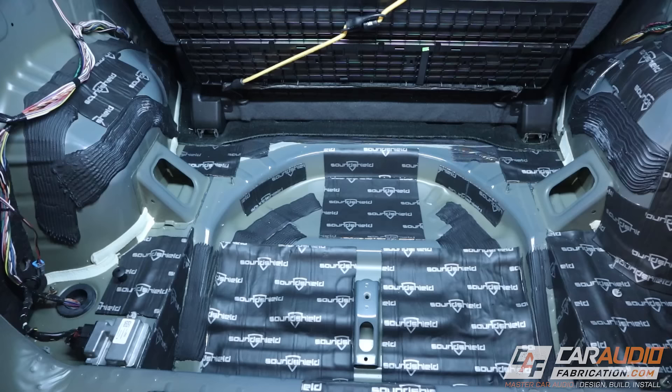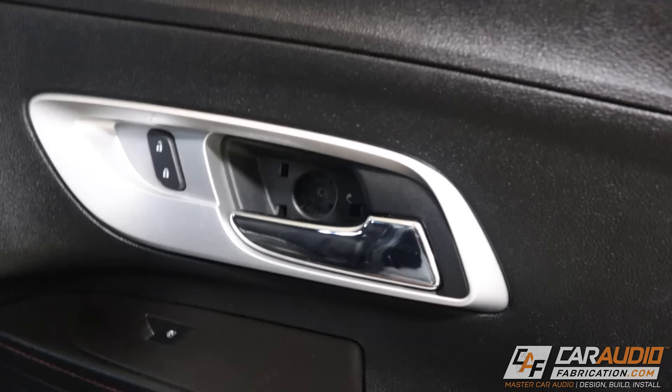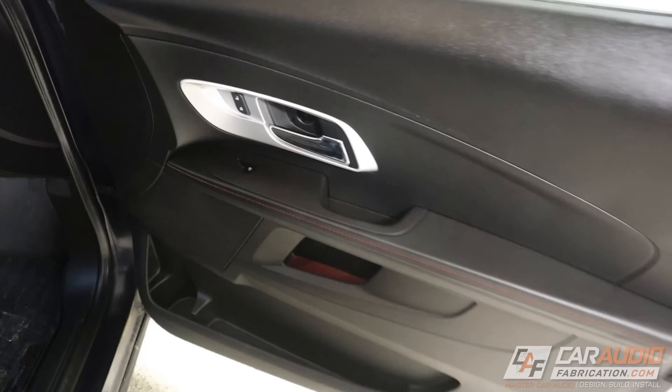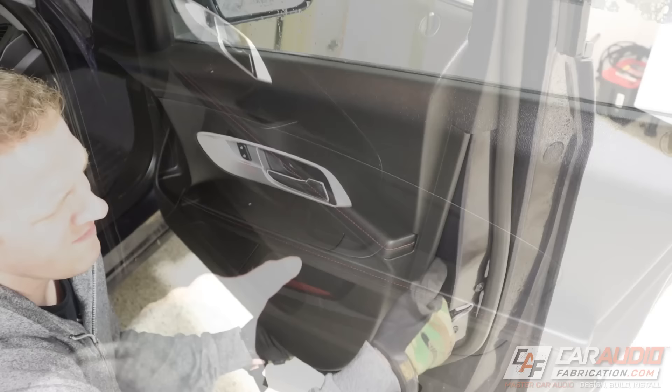We've targeted the important areas in the rear of the vehicle. Now to move on to the front doors. The first step for sound treating a door is to remove the door panel to get it out of the way. For door panels, you need to look for areas where it's bolted to the actual door of the vehicle. On this car, there was a little plate right here — behind the door handle is usually a good spot to look, and then behind the door pull as well. Sometimes there'll be another panel you can pry away around some of the switches that might be hiding a bolt. It really varies car to car, but on this vehicle it's just those two areas. So now I can carefully start going around the outside and prying the door away.